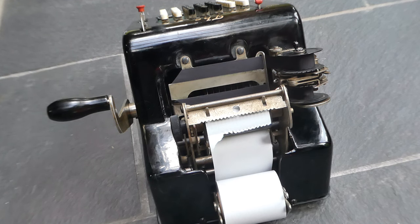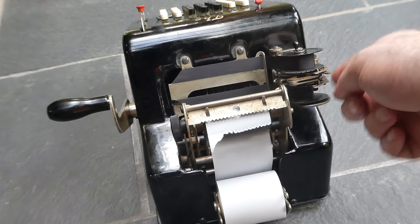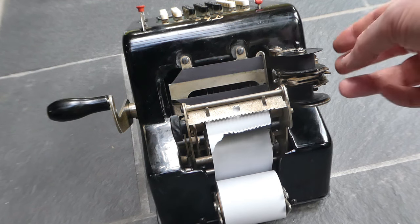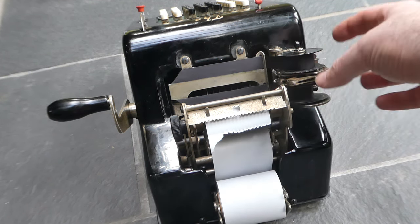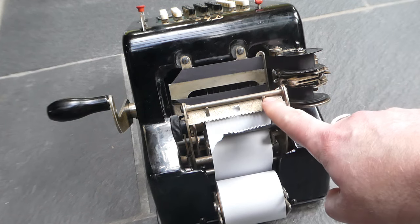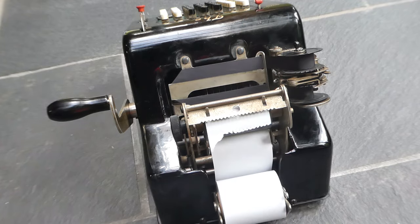The printing mechanism is greatly simplified. Both ink ribbon spools are mounted on the same side, so the ribbon has to be threaded through here. But that allows the advancement of the ink ribbon to be all compact in the same unit here. This is not connected to any other mechanism — it simply gets triggered when the paper roll moves past it as it presses into the ribbon itself.